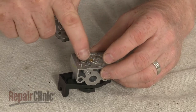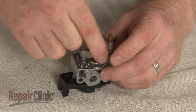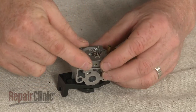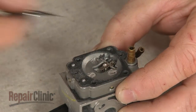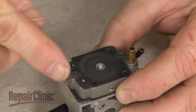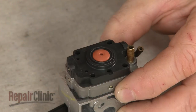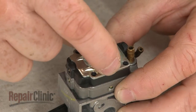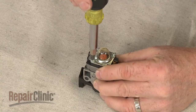Confirm that the spring, pump gasket and diaphragm, and needle housing remain properly aligned. Now holding the carburetor straight up, align the metering gasket on the tabs, followed by the new diaphragm. Re-position the metering cover and the mounting plate. Thread and tighten the screws to secure.